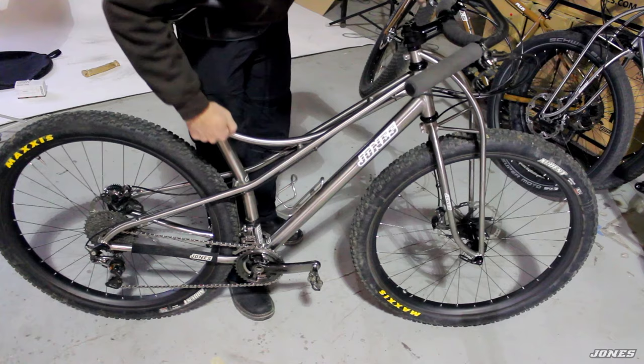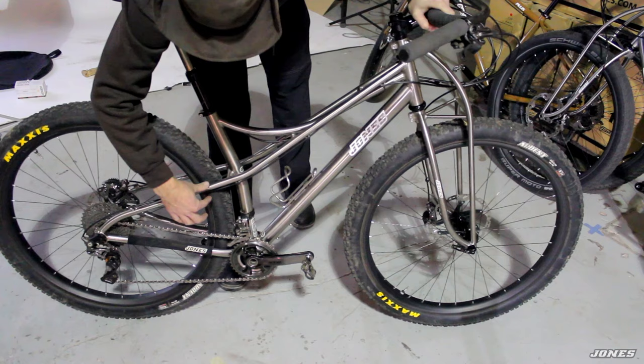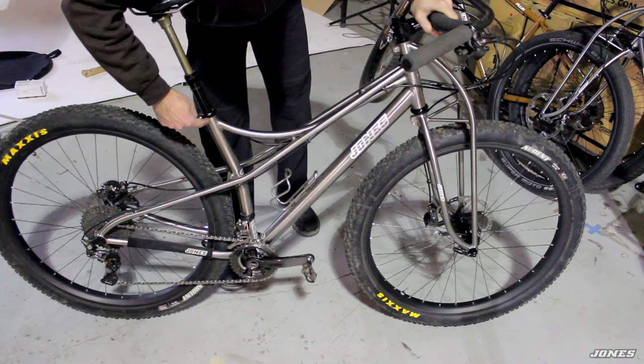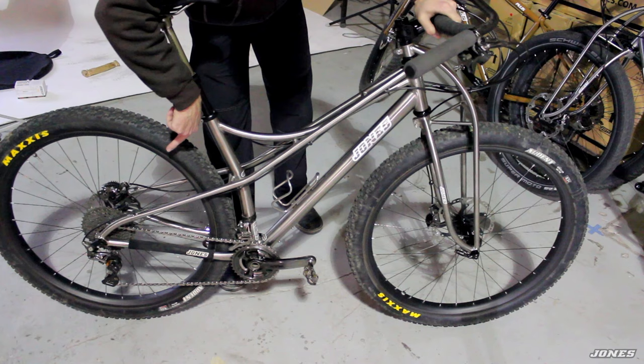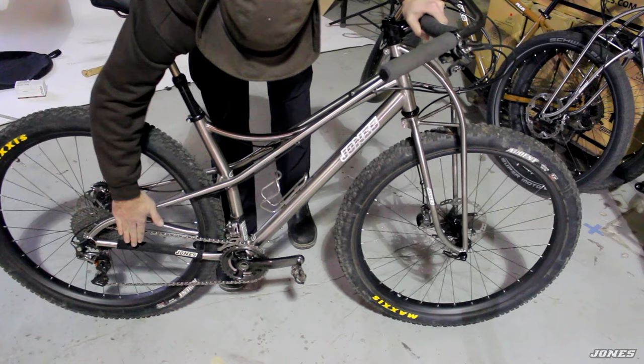A conventional diamond frame with the tall triangles is very stiff vertically and not as stiff side to side. I've changed it around so that the frame has less of a triangle in the back. These tubes are ovalized here and here so that the rear end can flex up and down a little bit. The seat tube here is not braced, so this tube can flex rearward, and because this tube is curved — like a spring — it will kind of straighten out and allow this tube to move. So we get a little flex back here, up and down, and the seat's moving back and the rear end's moving up.